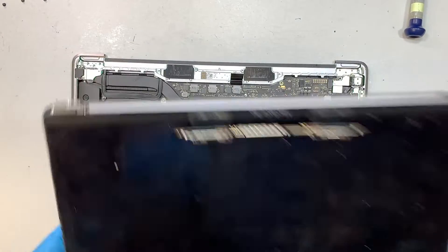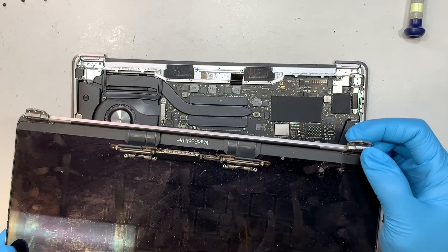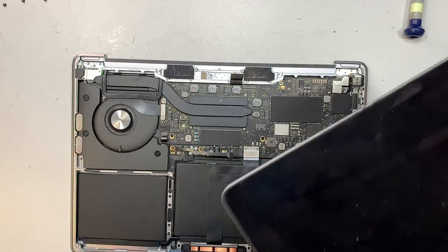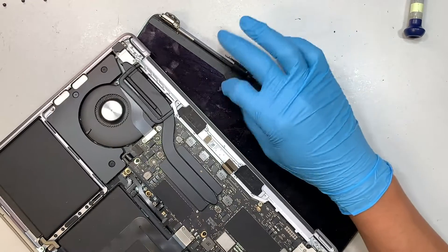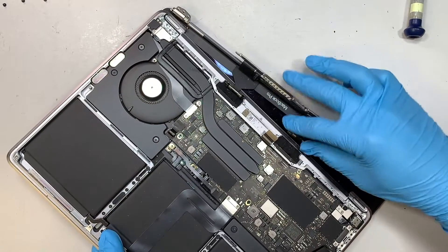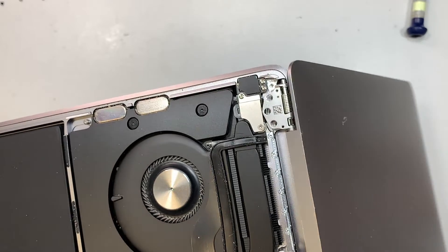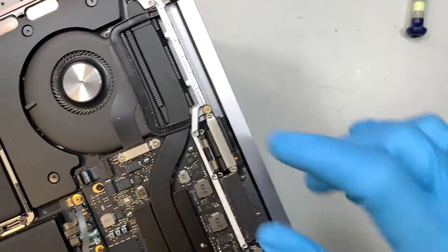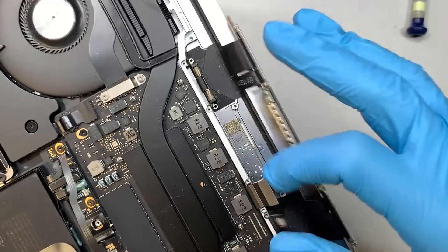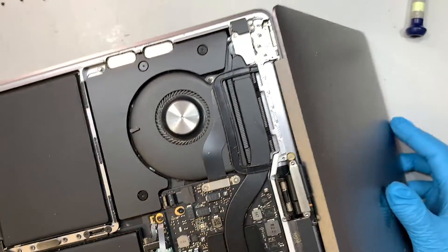Assuming the new screen has arrived, the first thing to do is open up the hinge to more than 90 degrees and flip it back on both sides. Make sure the LCD board cable is sitting above the laptop — flip them up so they're on top. Make sure the hinge is open and slide it in; do the same on the other side. Once the screen is slid in it will wobble slightly — double check that both cables are sitting on top, not clipped or pinched, and are free and clear.